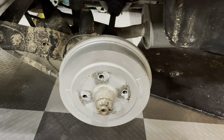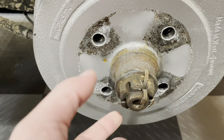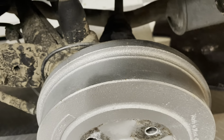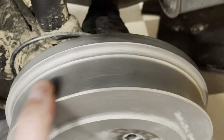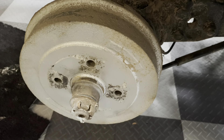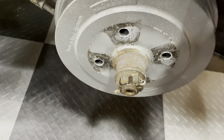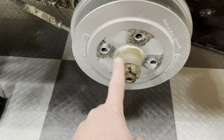All right, I've got the wheel off. Now all I have to do is remove this cotter pin — you can see it right here — and once that's out I can take off the castellated nut and pull off the drum. What I did notice, however, is even though the previous owner told me these drums are nice and fresh, this other side is not looking too great. That is no good, that's horrible. I think I'm just going to order two new rear drums so I know the brakes on this car are good.